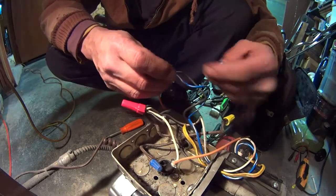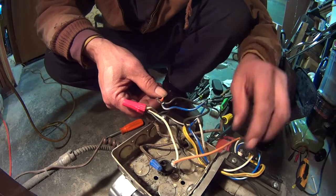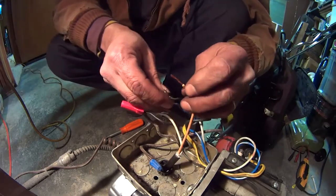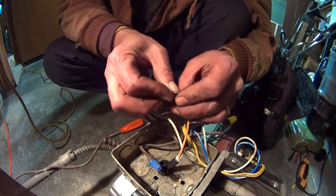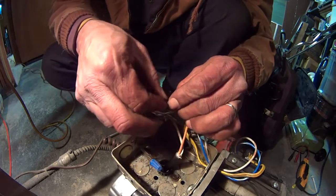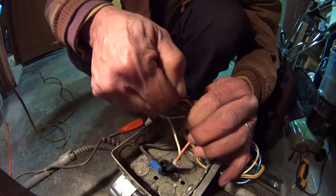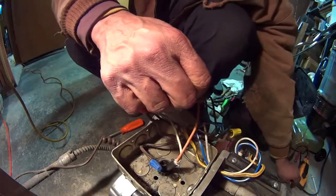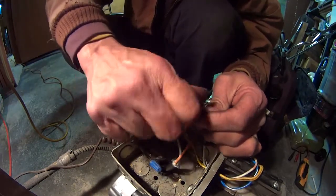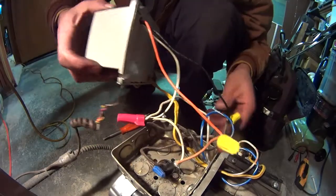And the only thing I got is this control everything, the igniter, the solenoid, and the motor at the same time, because this control is the old style chip control. Now they use the Genesee, everything is going separate. For this one, they use everything. Nothing wrong with the control, really. Basically, I kind of like it. So I see some of this control 20, 25 years. Never had a problem. Now the Genesee control, sometimes you gotta go back and replace it again. Got all kinds of problems with those controls.